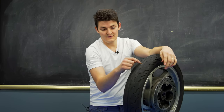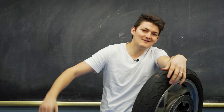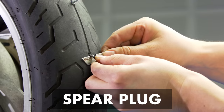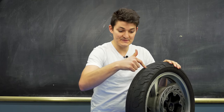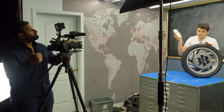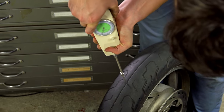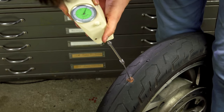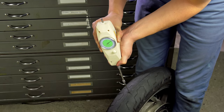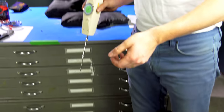Time to test the strength of each seal. Is the internal patch really so safe? Are the external emergency plugs really so weak? Or is it all a tire shop conspiracy? Here we have four identical punctures fixed with our four methods. We'll impart force to the repaired area with a push gauge until it leaks — this approximates running over a rock or something. The permanent patch has a whopping 460 newtons of resistance and actually punctures before unsticking. The gummy rope puts up a solid 125 newtons and reseals itself under pressure. Dynaplug offers a similar 122.5 newtons then leaks slowly, while the mushroom plug fights a pathetic 80 newtons before catastrophically deflating.